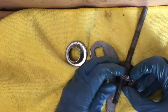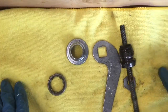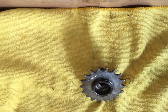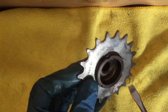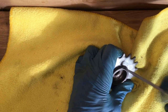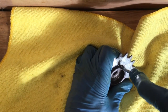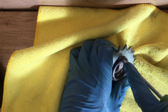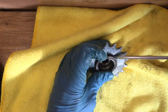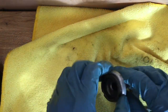Then you've got your bearing, which is going to slide over. Try to keep it as straight as you can but it will slide off. From there you can clean all those bits up. To get the little retaining spring off that holds the sprocket on, you want to get underneath one of the little three divots and work it up under that little retainer clip spring. Once you get it up under there, you'll pop it off just a little, then work it in between and it'll pop right off — just don't spring it into your eyes.